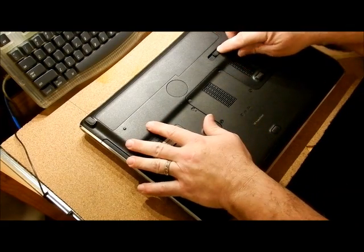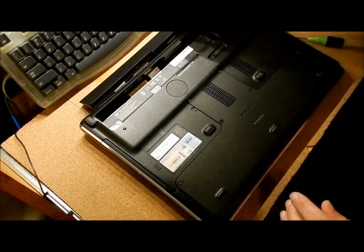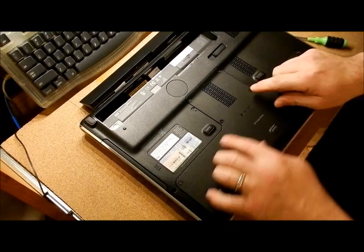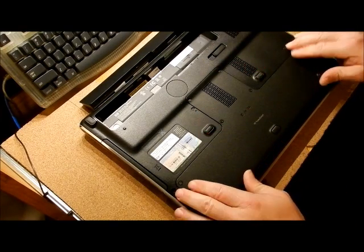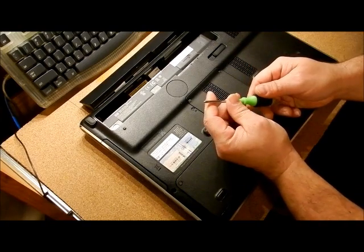The first thing you want to do is go ahead and take the battery out. You're going to wait for about 10 seconds. During those 10 seconds you can do all the screws — there are 6 screws to do. I've already loosened all but one. You do need a small Phillips head to do this.